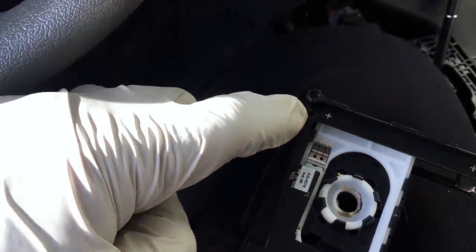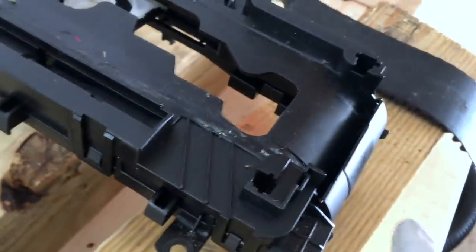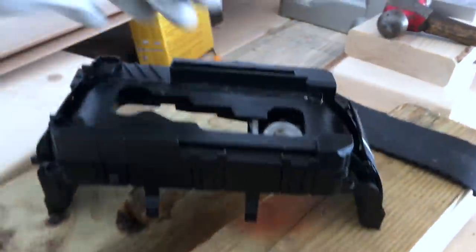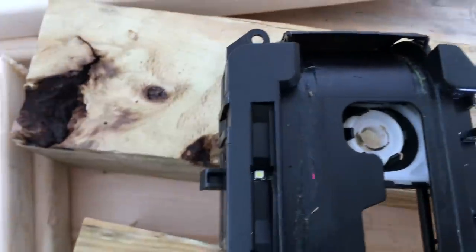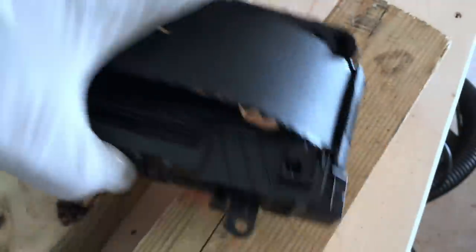Put your T10 screw back in. Work these plastic pieces very gently — they're thin plastic. Make sure all six tabs are in place and press it over. Remember your orientation: this side always faces left, this hole faces that way — that's the way it came out of the car and that's the way it goes back in. The rubber piece sits right behind it and drops in on top. As you shift it in the car it moves like that.